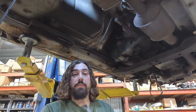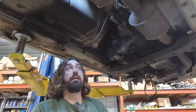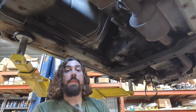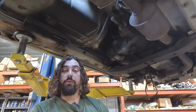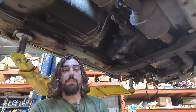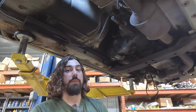The Hack and Tap Slip Yoke Eliminator is designed for the 27-spline output shaft transfer cases, to include the 231 like we're working on today, the 242, and also the 247 and 249 found in the Grand Cherokees. It might also fit other 27-spline output shafts, but the ones we've verified and know work are going to be within the Jeep family.